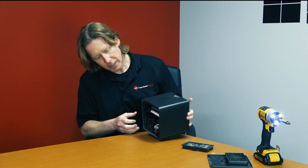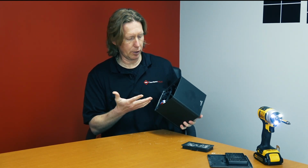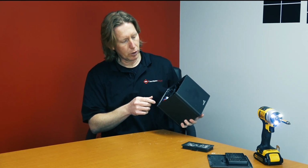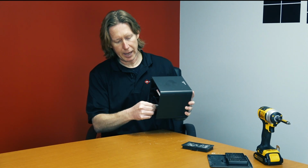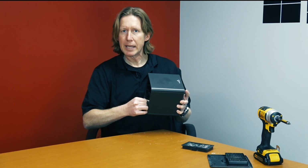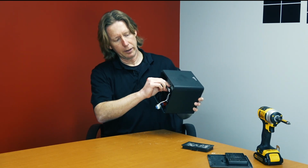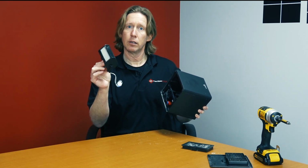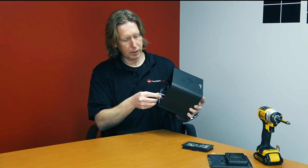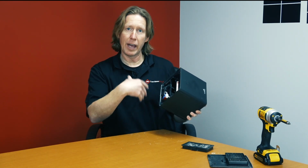You've got what's called an RCI cell, which is this guy right here. RCI stands for Radiant Catalytic Ionization, which is their patented little deal that they use to purify the air. So you can unplug this if you ever need to change this out. It actually gets changed out about once a year is what they recommend, because it is a UV based product. So it's got these little clips, and of course they're never easy to pull out. So you get that out, and then this guy just slides out. That's what it looks like. And you just put the new one in. Got these little guides that line up, and you plug it back in. But when you got it all out like this, you want to make sure you vacuum all this out.